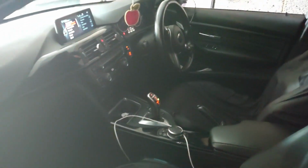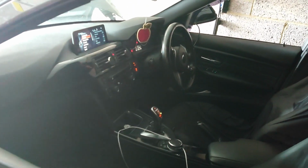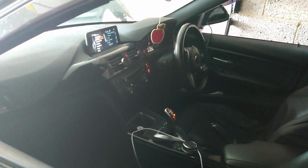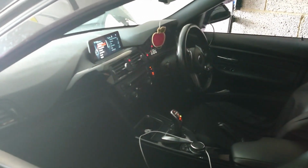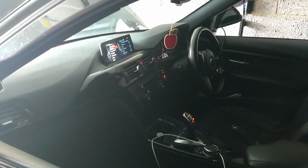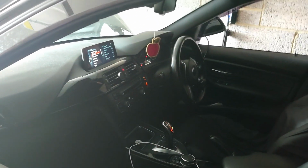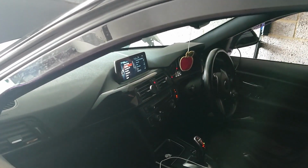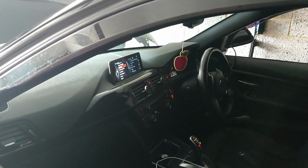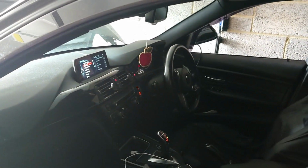Okay, what I can see is we still struggle in here for some reason. It still does exactly the same as it was doing before when you arrived. The pump is new, the rail is new, the sensors are working, but it still doesn't start. So I don't know, now there are two possible reasons. I will keep trying and see, because I haven't finished with the car yet. Even when I'm cranking, I can hear some noise from the chain. I don't know if it's some problem with the chain of the car, but the pump is turning at the same time I turn the crank, so I don't think the chain is faulty.